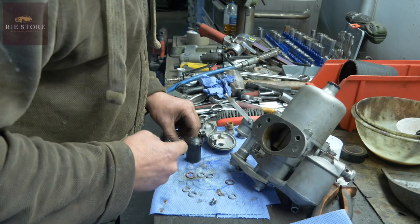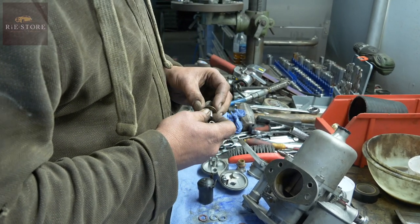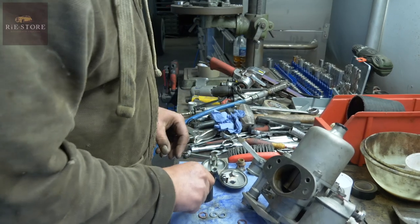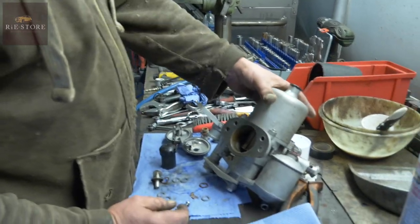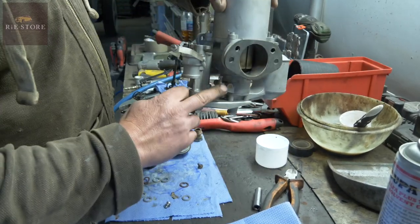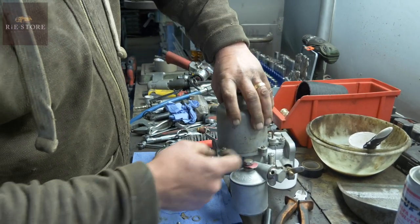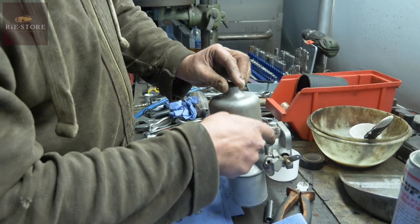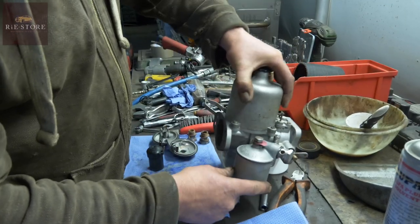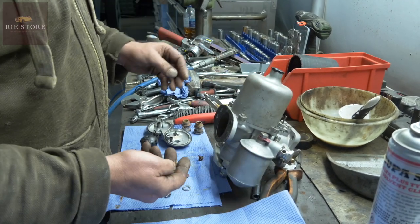So is there anything you particularly find when doing this that happens time and time again? Yeah, generally they're just set up wrong. Well, when they try to do maintenance on the car? They're quite an easy carb to do, because you haven't got an idle adjustment on them, you've just got an air mixture screw there. You've got a mixture screw which adjusts your main jet up and down for the strength of the mixture air-fuel ratio, but you don't have an idle setting. It's called an air bypass valve, so you adjust those to let less or more air in through that hole there, and that's your idle speed setting on them, which can be quite weird to do.